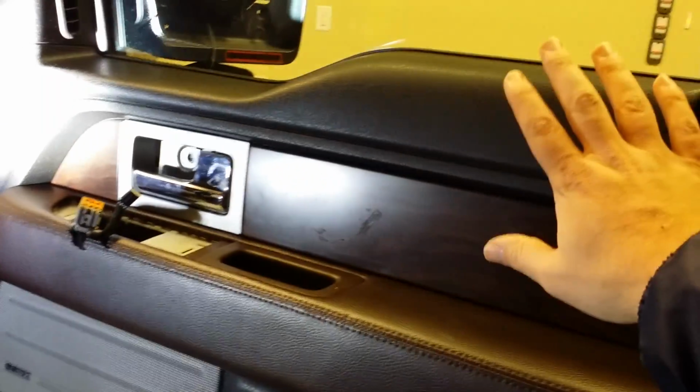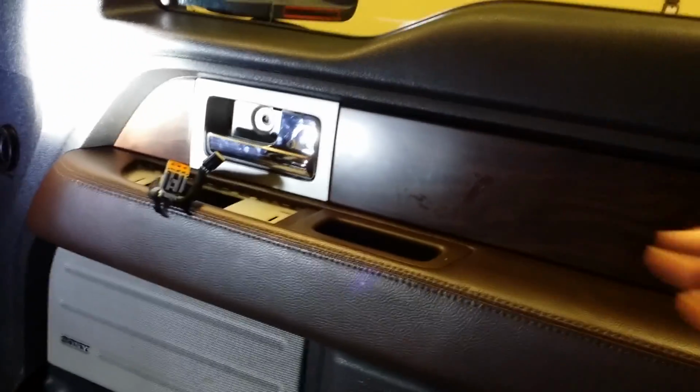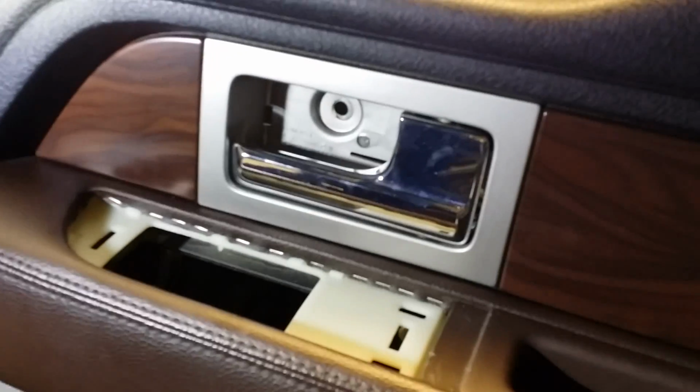With the switch plate and control modules removed, you can now focus to the last step, which is removing 2 bolts at the bottom side of the door panels. Here and here. With the necessary bolts removed, the door panel will now lift vertically straight up and off of the door. If your door has power mirrors located at the top, now would be the time to make that disconnection and to remove the door handle from the door panel.